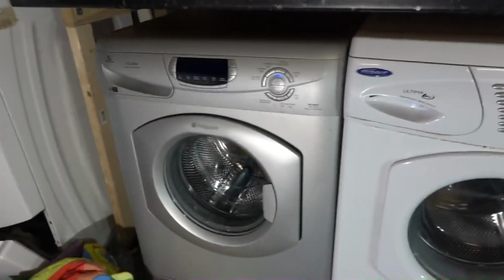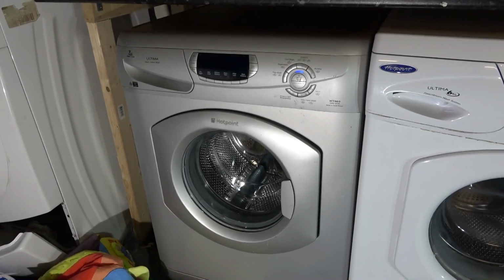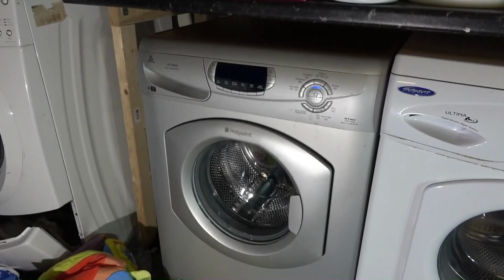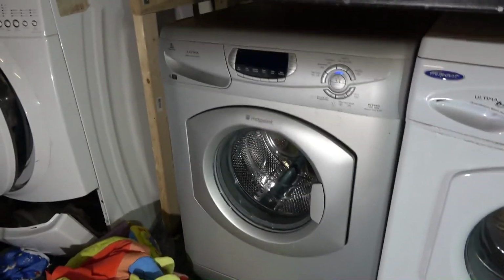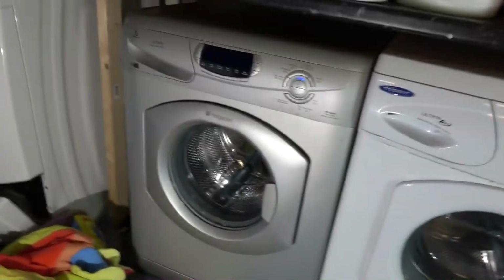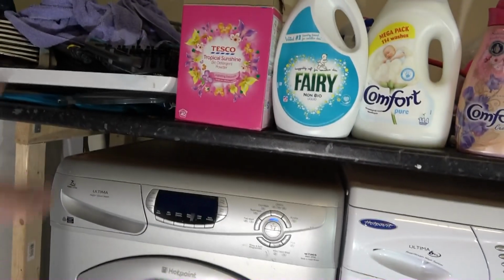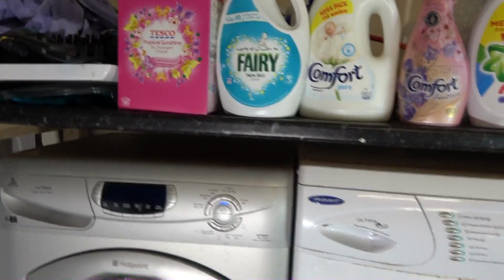So the Indesit design had a couple of problems. One, there was a recall on some of the drums because they would tear apart. That's because there's no rigidity. And the other thing was, it was a sealed unit, of course. So when the bearings did go, which they would go. In fact, it was actually the spiders that mostly went in the end. It was the end of life of the machine. But they stuck with some of the design to that point.